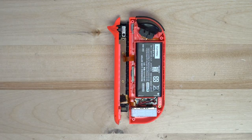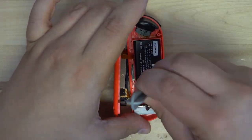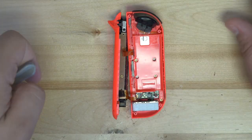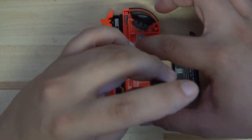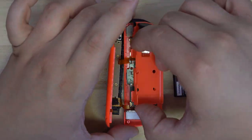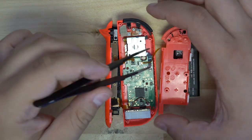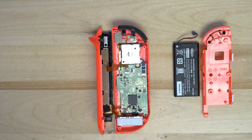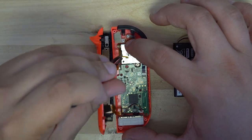Just like the other controller, we need to disconnect the battery first before prying it out. There are then three golden 00 Phillips-head screws that need to be removed. When they are removed, you can flip over the middle bracket and disconnect the ribbon cable. Finally, there is one more ribbon cable blocking one of our screws — we can disconnect that as well.